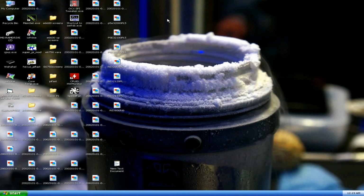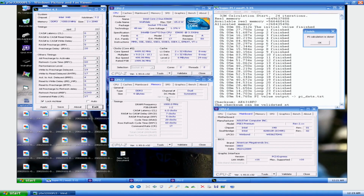Now the second one of the boards was bought from Allegro.pl. It's a Polish eBay style website, and this particular board, which I'm also running at the moment, was able to do the same 2000 MHz memory profile with 675 timings and performance level 5, with a Northbridge voltage of 1.55, 1.57 or so. The performance level 5 obviously requires the 200 MHz strap, so it's not possible with any of the other available straps.